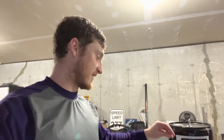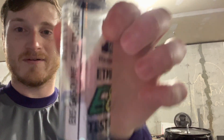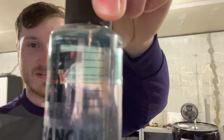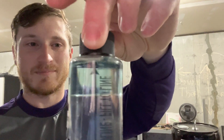First off, let's start with how do you test E85. You need an E85 tester. It will come with two lines - a big blue line that says water fill line. You fill the water all the way up to there, then take your E85 and fill it all the way to the upper line. It will separate out - you can see a clear line. I went ahead and put a fuel stabilizer in it, which is colored blue, so you can more easily see the difference. There's a distinct line between what is E85 and then the gasoline up top, and that's how you read the number where it gives you your E85 percentage.